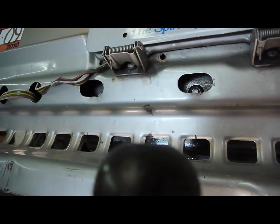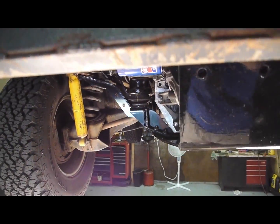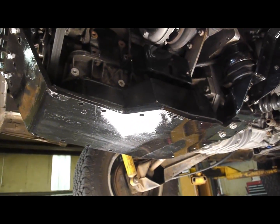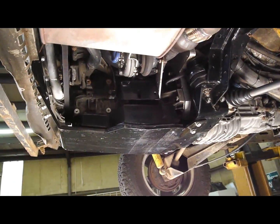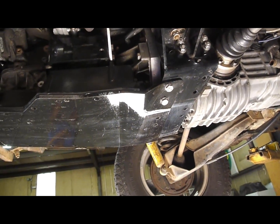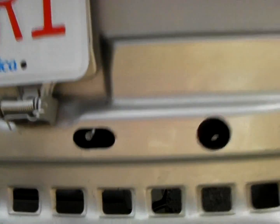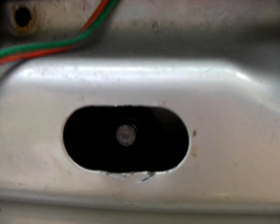Those are the three bolt points for the rear of the cradle. You can get into those holes with a 15mm socket and it uses an M10 bolt with backing plates on the back side. Then the rear bracket catches the lip of the body, so the bolts are actually holding the bracket to the van. You can see it's catching that cross member, so it's actually not the bolts in shear that are supporting it. The bracket actually bends 90 degrees underneath it.